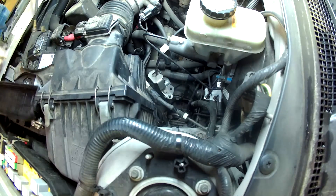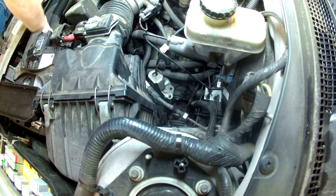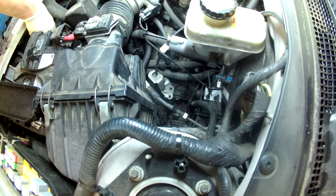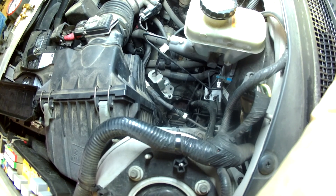You can also use a fuel pressure test to diagnose a possibly weak fuel pump. If you have a running issue, you may be getting fuel but just not enough, or not at a high enough pressure. You can also use it to diagnose fuel pressure regulator issues — there's a lot of things a fuel pressure test can be used for. Please give the video a thumbs up, subscribe to the channel, and we'll see you on the next one. Don't be afraid to get your hands dirty.